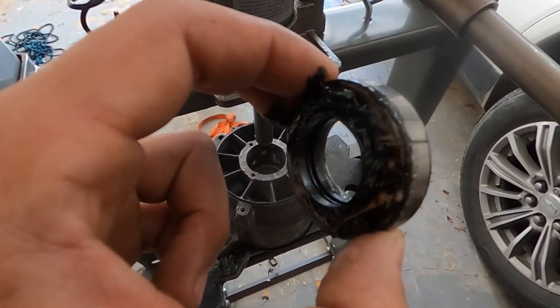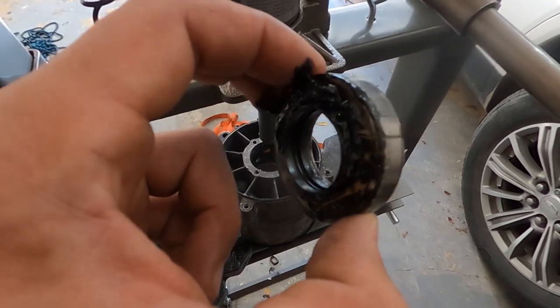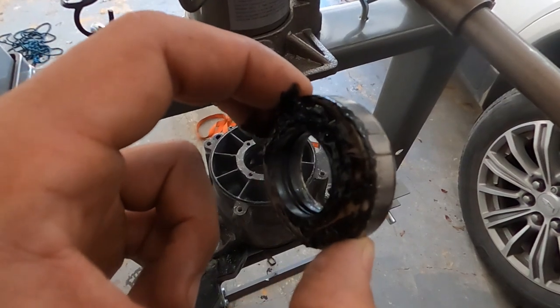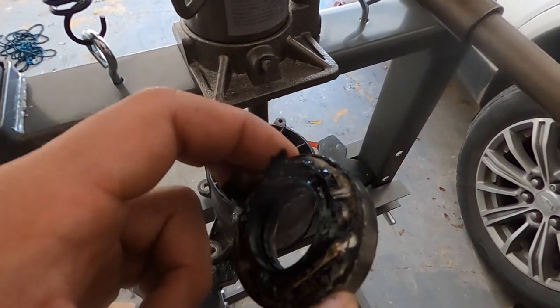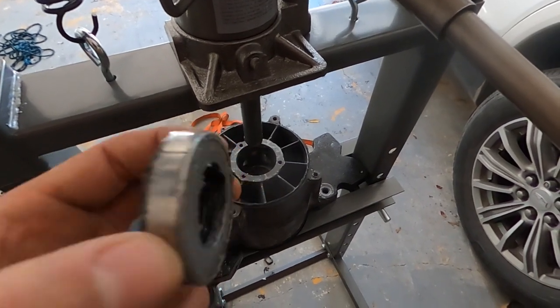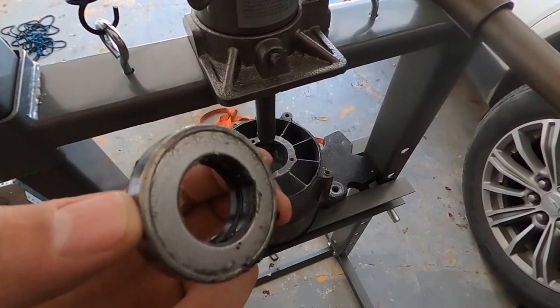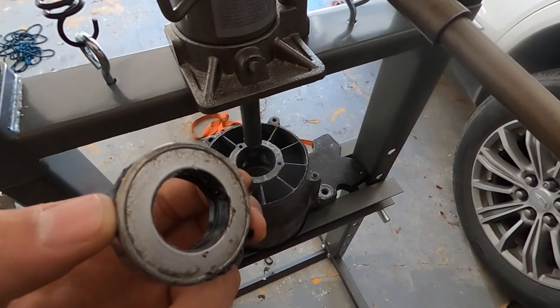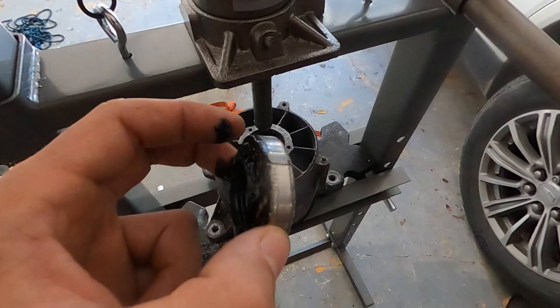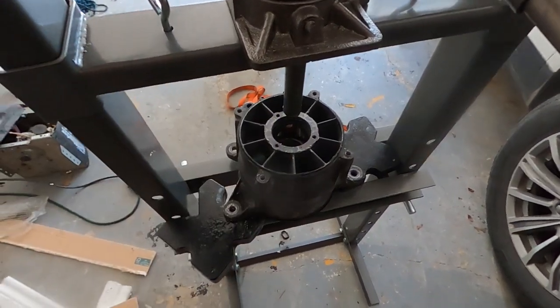They're actually on the new seals. They're actually pointy, and they mate to the shaft for a perfect fit. So that's why it's important to have a shaft that's true and round, so that your seal doesn't get any gaps in it. One, and then two, obviously, if something is spinning or rotating, you don't want it to have a wobble in it.